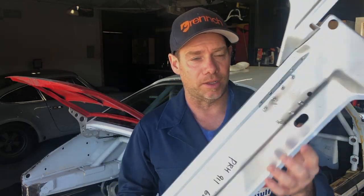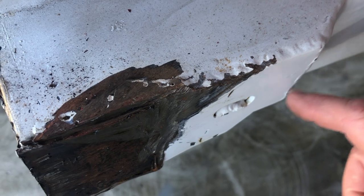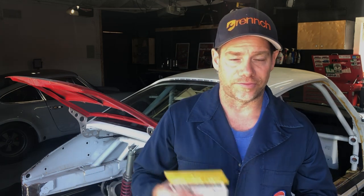What I'm doing today is continuing to fit this panel, which is the inner part of the rear of the car. I couldn't fit the whole thing on there with both motor mounts, so I drilled out the spot welds on this side. I still need to remove a bunch of the 1/8-inch thick steel plate that the previous race car guy had installed. I've gone to Harbor Freight and picked up a whole bunch of 36-grit discs. I'm hoping these just make short work of the welds and then I can pry off the steel plate.